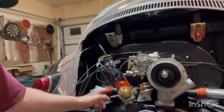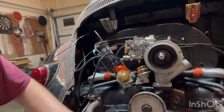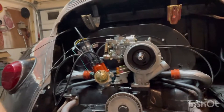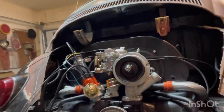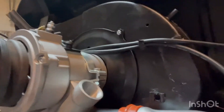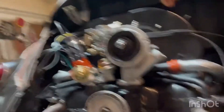We got some new gaskets here — I don't have the hose clamps on yet. We got all new rings in the engine, all new seals and gaskets everywhere else. I've done a couple little things here since I'm not going to be running the heaters — I came in on each side and cut those little tubes off and welded it all up.